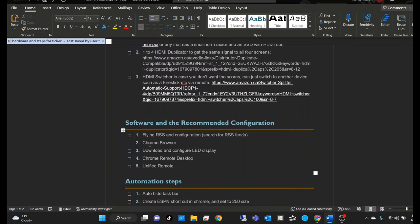Next, close this down — you obviously need a Chrome browser. Item three is downloading and configuring an LED display for custom messaging. Chrome Remote Desktop you can install on the tiny PC itself, then use that to open it on your phone to manipulate and pick games. If you didn't want to do that and you're in front of the mini jumbotron, you can also use Unified Remote — there's an app for both Apple and Android, and on the PC side you just set it up as a server. Go to their website, download it, and the link will be in the description.